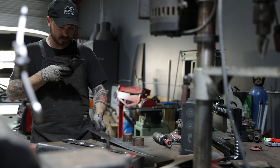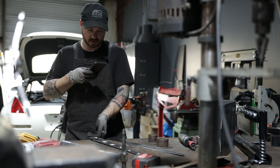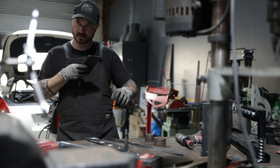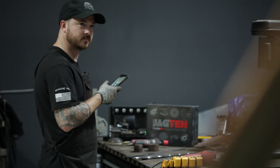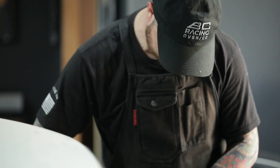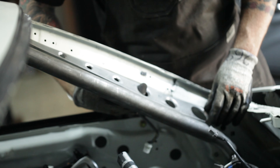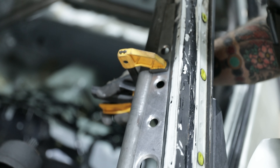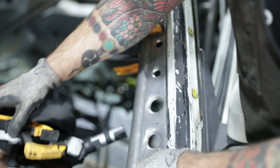What this does is it takes this super wobbly piece of metal and makes it super strong. This is a great way to make a stronger section. Today, we're working on the gussets that go in front of the roll cage — just a piece of metal with holes in it. Well, those holes do serve a purpose other than throwing that cherry on top after the cage is done. They help attach some points and stiffen some areas, while dropping the weight by cutting out material, but gaining rigidity due to how it's made.